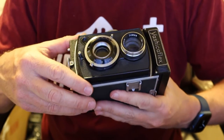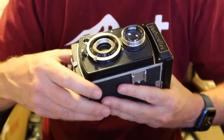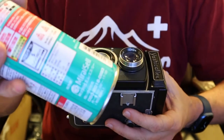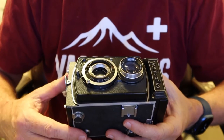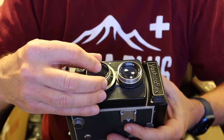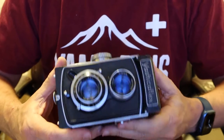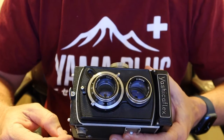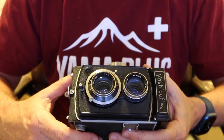If the shutter is sticky, I use my most favorite tool: Zippo lighter fluid. A drop or two on the shutter blades, cycle the shutter a few times, then blow it with a little canned air — you can get those on Amazon or at the dollar store. Do that a few times and it usually gets the shutter running within the ballpark so you can take good photographs. When the glass and lens elements are all clean, simply screw the lens back on. For myself when I service these cameras I do more thorough work, removing the shutter and cleaning the mechanisms individually, but for ordinary use it's not necessary to get too deep into one of these cameras.